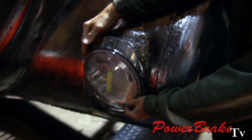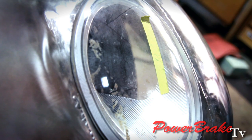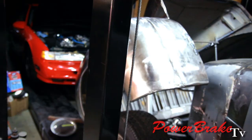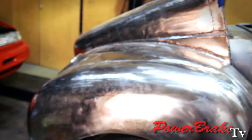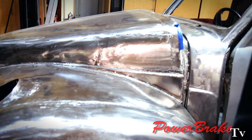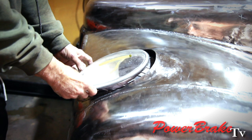The fact is, we thought the headlight was really going to sit about like this, and there would be this metal taper behind it. We may end up with this positioning, but the headlight we were going to use may have different guts in it — we'll probably just use the lens and build a different kind of light inside it. How good the fit is when this thing comes down onto the cowl — still a little adjusting to do, but we're right there at our eighth inch, and that's before Bondo.